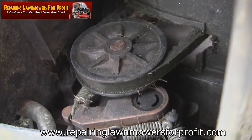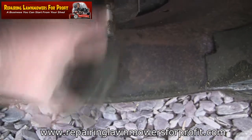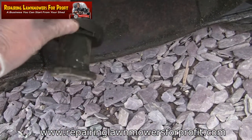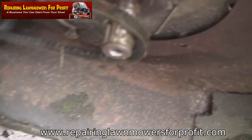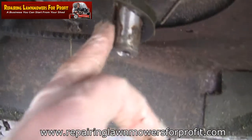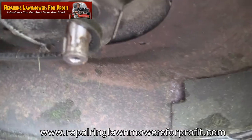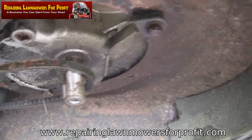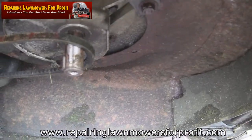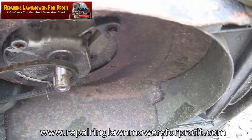I'm going to try and get this blade boss off underneath this blade adapter. You can see the top of the shaft here - I'll just tap it at the side with a hammer. I've managed to just drag this down. I really don't want to pull the belt off on the back. I'll drop this old one out and swap it over. This keyway here - someone with a mower that won't start needs to check this. This part slides in here, and if there are any imperfections it will cause it to fail or not start even if you have spark and fuel. These keyways are designed to break on impact rather than bending the actual crankshaft that goes through the engine.